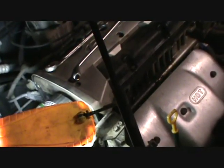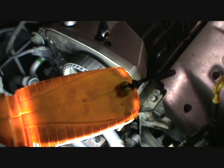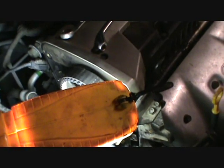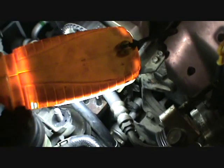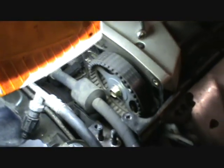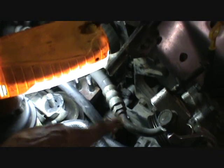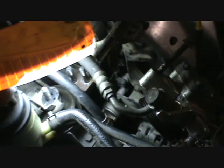If you got one that's making a noise, like if something up here is going when it's running, that's either a water pump going bad, or it's one of the tensioners maybe on this timing belt going bad. So you need to look into it for sure. You don't ignore some kind of a noise up here, in this end of the engine. That could be fatal.